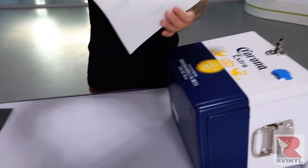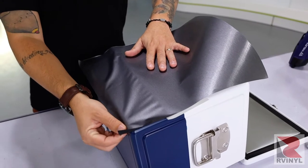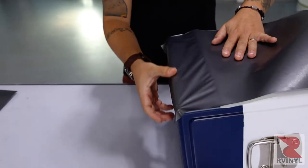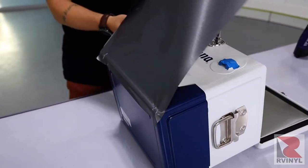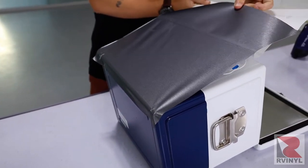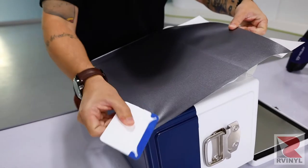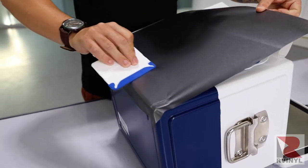Take the piece, pick it up to the section being applied, and lock it in on one edge. The free hand holds the panel in position — make sure there's even tension left to right — then lock it in with the thumb. Keeping the liner on, pull it roughly halfway, pull the material low and flat, grab your squeegee with a monkey strip, and squeegee back and forth in even, firm strokes.